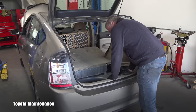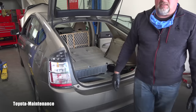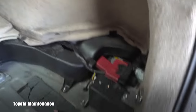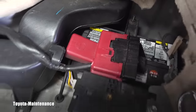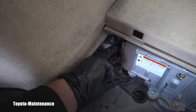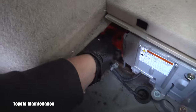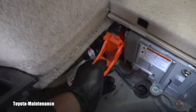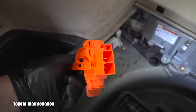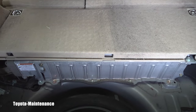A little tip: many times — not in this case — that triangle of death is connected to a bad auxiliary battery, which is the small one right here. Anytime you have these problems, always make sure it's in good working order. The cooling fan is hiding behind this cover. To disconnect the main plug, you use the orange plug — use your finger here, pull up, tilt it, and that's your first main disconnect.